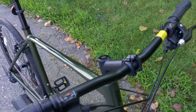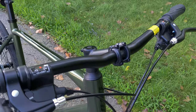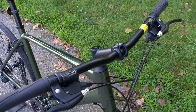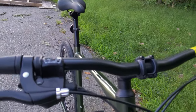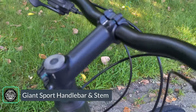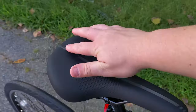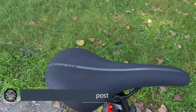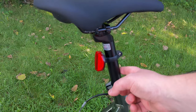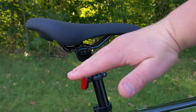Cockpit components are a bit more standard, though the shot-peened black finish looks great. This is the Giant Sport Flat Handlebar — called flat even though there's a tiny kink of rise — going through an aluminum stem with a 25.4 millimeter bar clamp. Out back is the Giant Sport Saddle with a nice relief channel down the center and decent cushioning, mounted on a 27.2 alloy seatpost with a single-bolt design to adjust saddle angle.